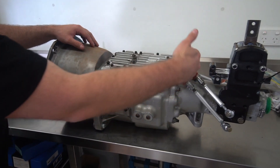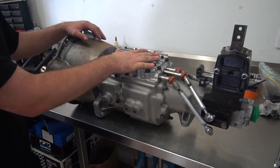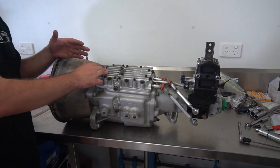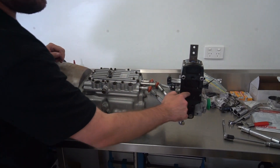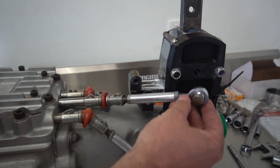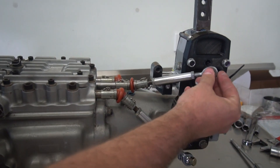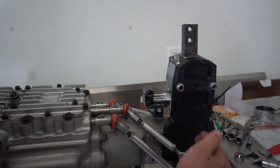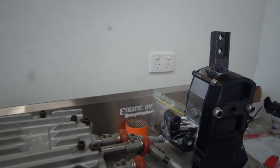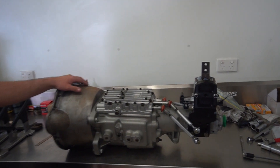The reason I selected it is because with the shifter being directly in line, I can use a modifier - this was 3D printed from a mate of mine - to simulate the new offset. These bars used to sit up here. You can see how much I've shortened the shifter to get it to where a factory K70 or A86 will fit. The difference from the face of this bell housing to here is exactly that of a T50, identically.